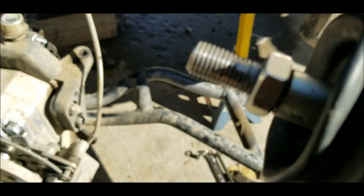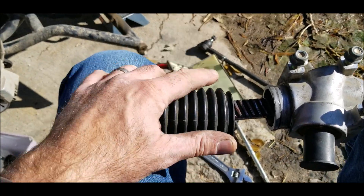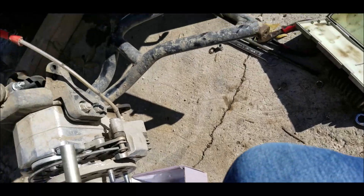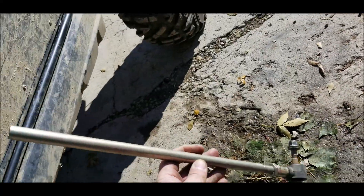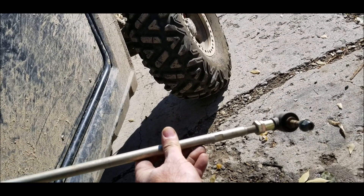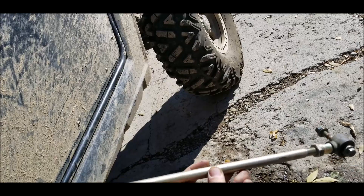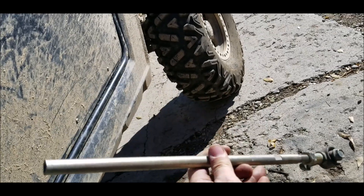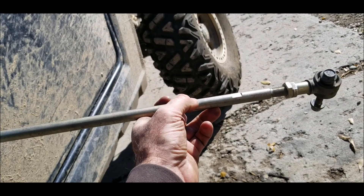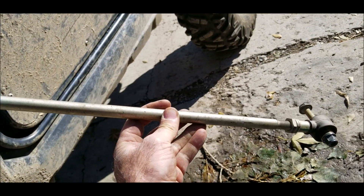I was first looking at the 1,000 rack to see if I could make its parts work. This is the inner tie rod end from the 1,000 — it's pretty short — because the tie rods themselves just look like a tube with the tie rod end and the same 10mm bolt as the 570s have. The only difference between the 1,000 rack and the 570 rack seems to be this inner piece — a little heavier duty. So an option is to take this 1,000 piece, cut out the distance you need to match up to your 570, weld the sleeve back around it, and screw it right into your rack — using the factory inner tie rod end and the factory tie rod off the 1,000.